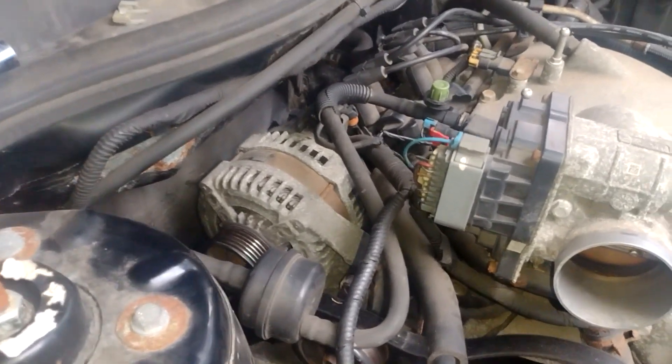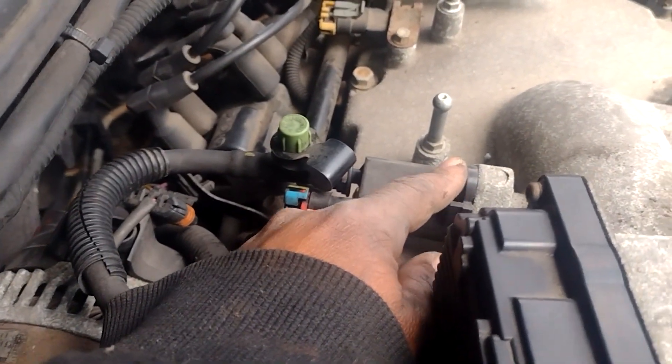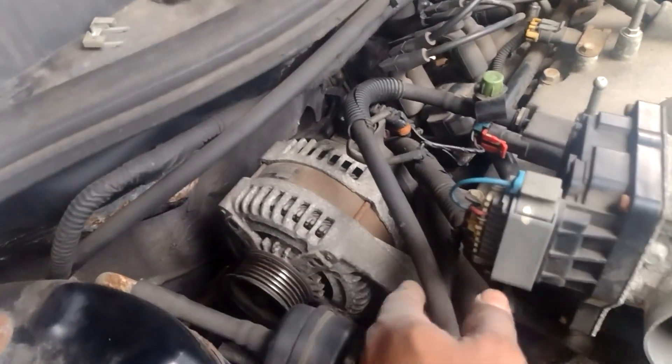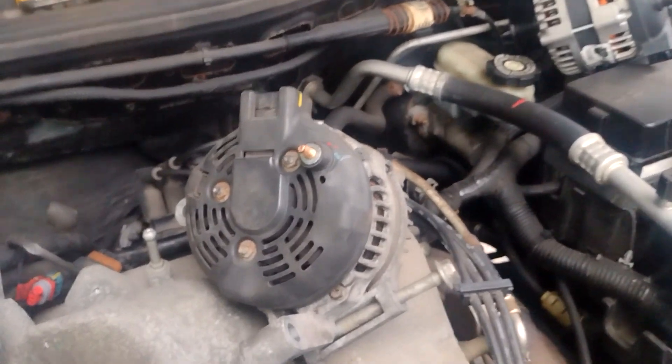You can see me lifting it up as far as it'll go. You got to pull the alternator out. I'm assuming when you put it back in, you got to have that bolt in before you install it. I'll have to take out this one 10mm bolt, release the pressure here, pull that line off, take that bolt off, take this whole thing out and move it up — because that's what's not letting the alternator come out. Now we got a little bit more space and it should come out. I got the alternator out. We already matched it up, and yes, it does come out through the top.